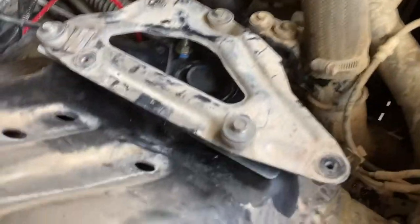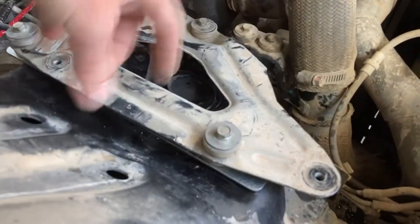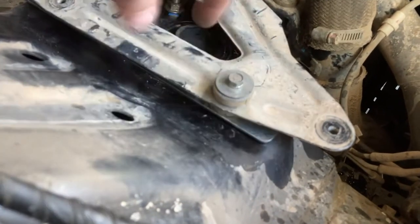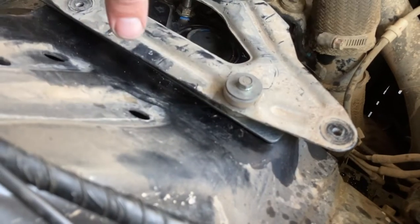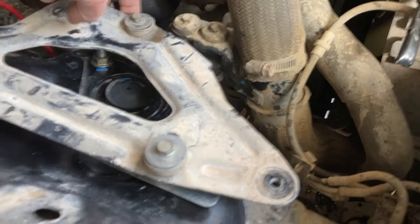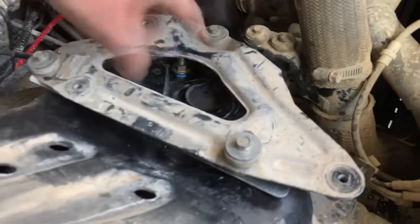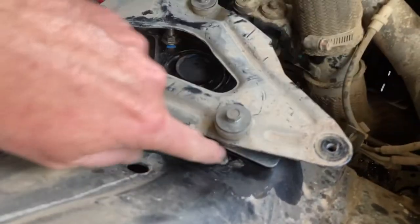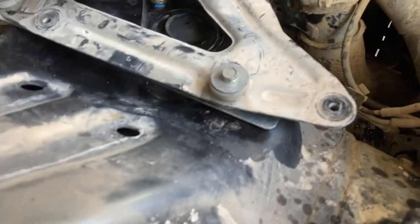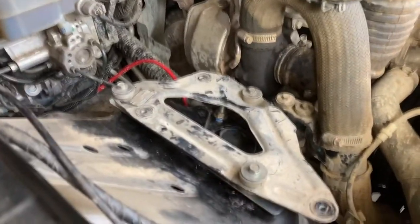So I'm a few steps behind with filming. It's pretty complicated, but anyway, you need to move this. This is the original one. This is the one they give you in the kit. Basically, this guy has to shift 25 mil from the original hole. So we drill a hole in there, 16 mil and 12 mil, I think it's 12 and 16, to put the spacer with the washer, and then you put the original screw to tie this spacer again. Hope it makes sense. It's a pain, yes.